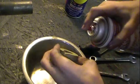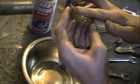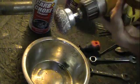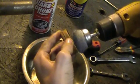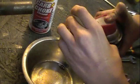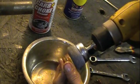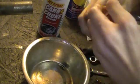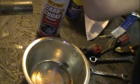What I'm going to do is just take my carb cleaner and spray it down. This probably isn't going to do much for the rust, but you can also take a wire wheel on your drill. WD-40 will probably help too. Now you can take your main jet, kind of shine it up to the light, and if you can see through it — I can see that some of the holes I cannot see through.